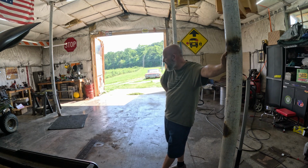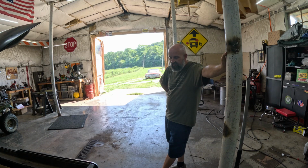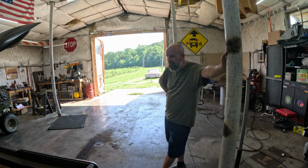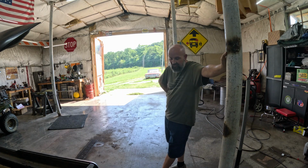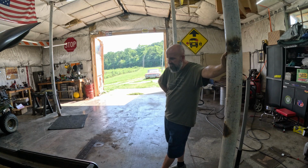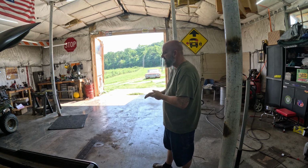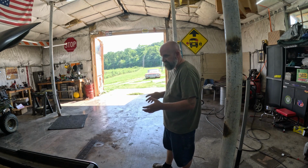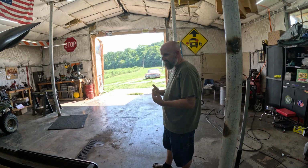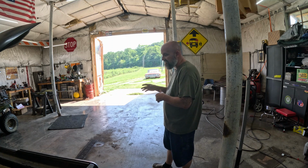And I mean, cheap switches or whatever, they're all about the same when you order them. Set up the same anyway. You can get some really high-end Firestone switches, about $50-something a piece. But what I'm thinking now is I really like the setup on Bubba's Thunderbird. It's just two switches, up and down, front and back. He's got three lines that actually come in the car. The difference between it and the 60 is, the 60 has four switches. It has one switch for each airbag. I did not want that intentionally when I got it, but they were all out of the two switch setup, so I had to go to the four switch.